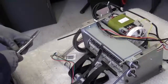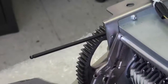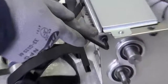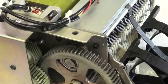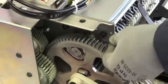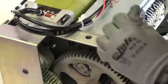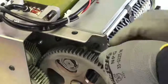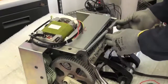Once you break your Loctite, get your vice grips and clamp only on the cutting block bar here, going through and under, so we are not spinning this bar. Now that we have our vice grip holding on the cutting block bar, we are going to remove the right hand screw of the cutting block bar. Now insert the small end of the five millimeter Allen key wrench and with your vice grips in place, push up on your screw — just loosen it, do not completely remove it off the bar. Once you get enough of a vantage point, you can move this bar. You only need enough gap to slide this off.